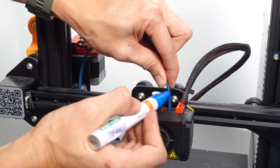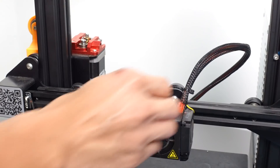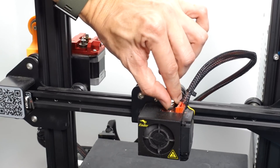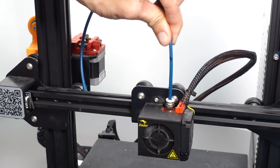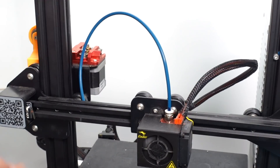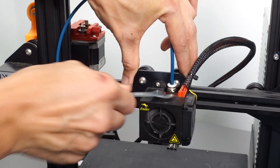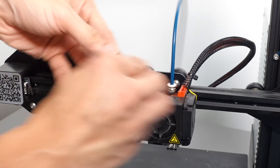For the hot end, we must make sure that the tube is all the way down and it touches the nozzle. I'll make a marking to make sure that when I do it with the pneumatic coupling, I get the same length as well. So just hand-screw the pneumatic coupling all the way down, and then unwind it back one turn. This is to make sure that after inserting the PTFE tube, I can fasten it to make sure that the PTFE tube is snug tightly towards the nozzle. I'll push the PTFE tube down, double-check it with the marking, and since it's all the way in, we will proceed with tightening it using the wrench. Don't over-tighten it because it is hot and we can easily damage the thread. Once it's in, just fasten it using the blue clip that was provided with the Ender-3.